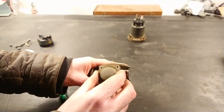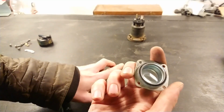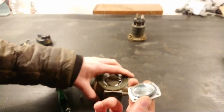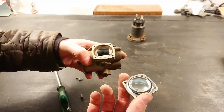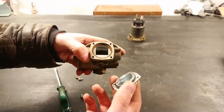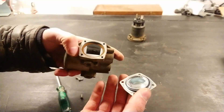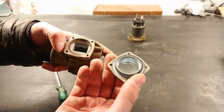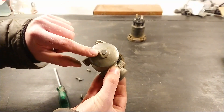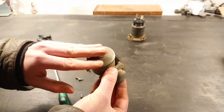This is the outgoing fuel chamber — here's that thin, thin little membrane inside. So that's all that chamber looks like. If you're rebuilding one of these you'd replace that. But if you're just taking it apart to look at the points, don't open these up because you might damage them — they might be working just fine and they're very delicate.